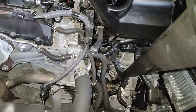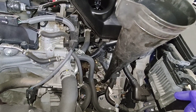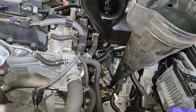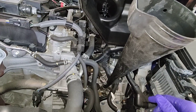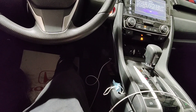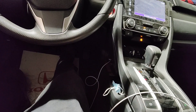To fill it, just grab your funnel and put it in the fill hole. This is gonna take about three and a half liters, so four bottles of CVT transmission fluid will be more than enough. I dumped in four liters of HCF-2 — might as well, since you're gonna level check it anyway.